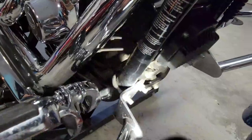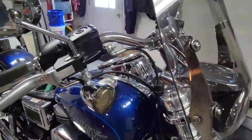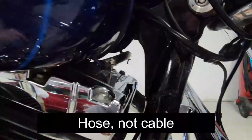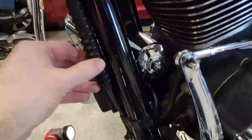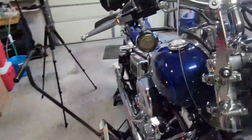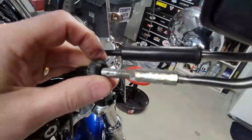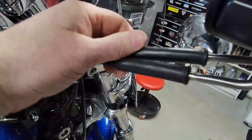You also want to be lubricating your cables on a regular basis. The clutch cable comes down under the bike in a braided cable, and you want to make sure it didn't get caught on the jack when lifting the bike. Inspect it underneath and follow the routing of the cables, making sure nothing has any scrapes, abrasions, or damage. Here's the crossover cable between each side of the fuel tank — just a visual inspection. When I bought my Sportster and pulled back the rubber covers on the throttle cables, I found they were all rusted. Make sure those rubber covers are in the right position — maybe use silicone grease to seal them.